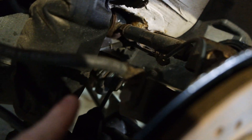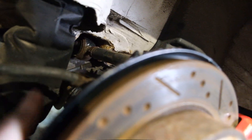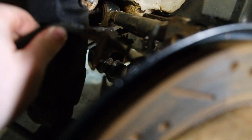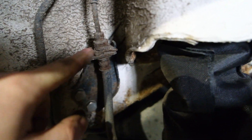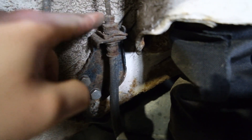So I'll just find out what size this is. It's actually a 13mm that you'll need to get that off. So I'll just go ahead and get that bracket off now. So now that's out, we'll just get that bracket off — that was fairly easy, thankfully that bit's not rusted on. I'm expecting this bit will be where the little C-clip comes out, so it might be worth spending a bit of WD-40 on. Then this clip will pull out and disconnect it there.